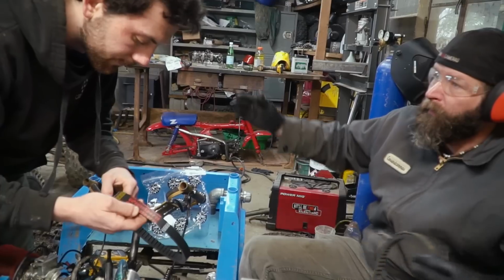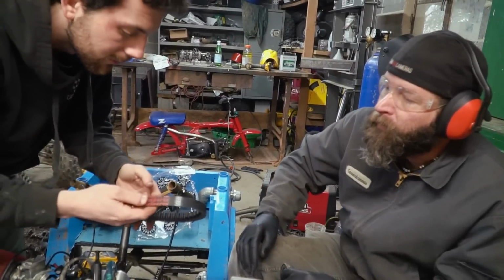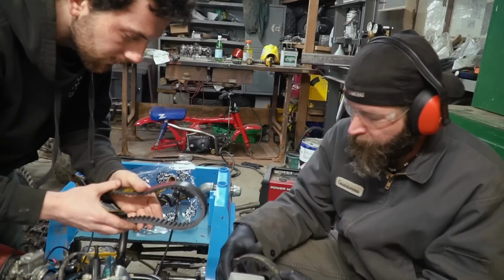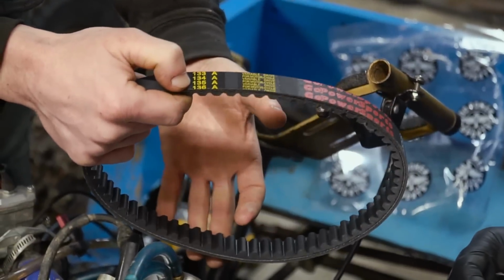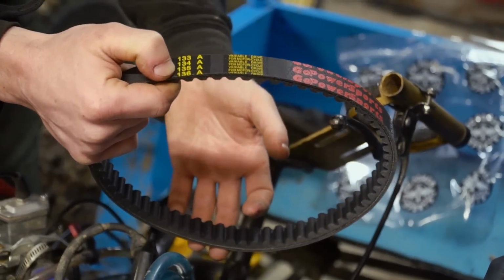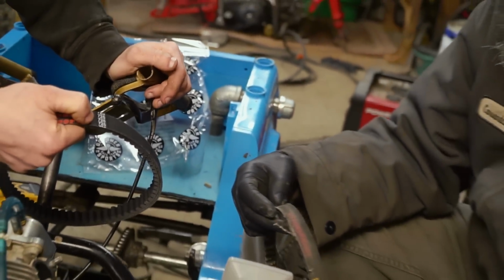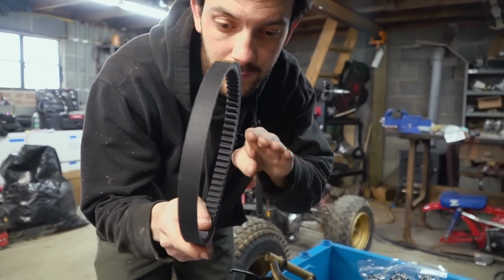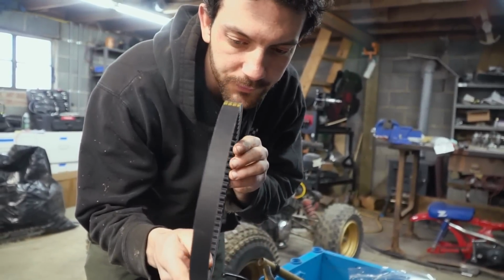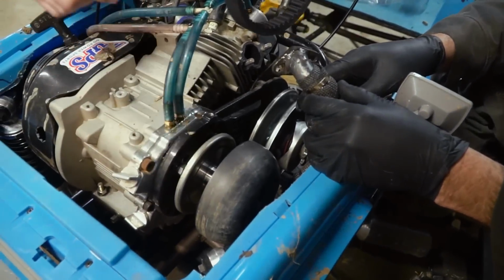You know, belts come in a huge roll. And they cut them. Like a batch number or something? Could be. I got 135C. I mean, there's 133, 4, 5, 6. Okay, well that's the batch. I got 725. Okay, that's probably it. One side of the belt will be flat. The other side will be kind of tapered like that. You put the flat side up against the flat part of your driver.